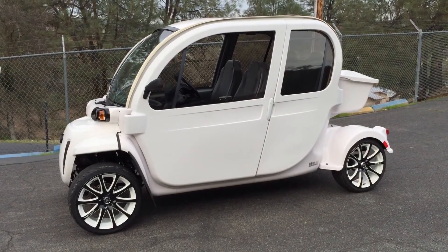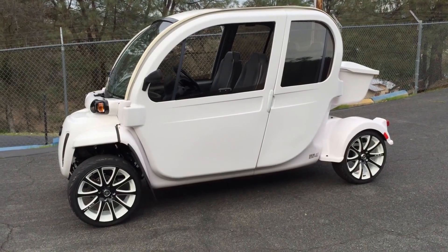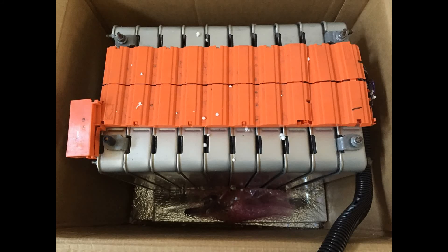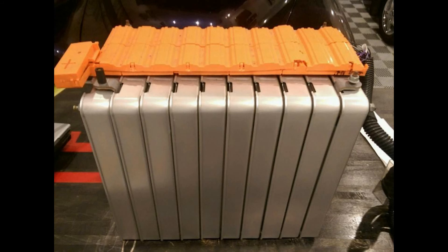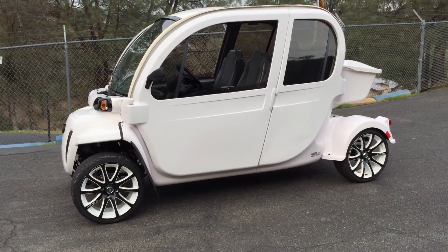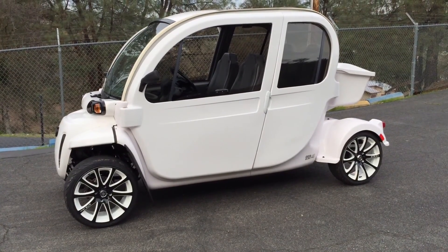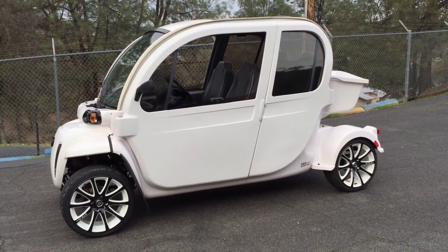DECA's website says each battery weighs 70 pounds, and we have six of them, so that's a total of 420 pounds. The new lithium pack is supposed to weigh under 90 pounds, so that's a net loss of 330 pounds. And if you know anything about these cars, you realize that that's a lot of weight as far as performance goes. So we'll do some tests and see what kind of numbers we get out of the hill climb.